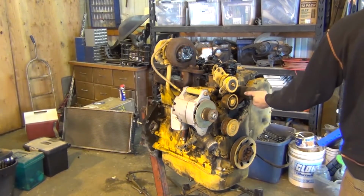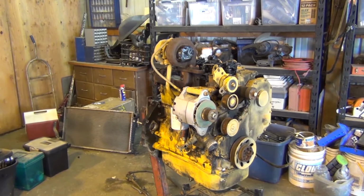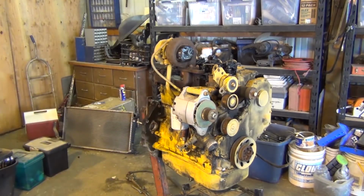Somebody's gonna comment and be like, "Hey, you should have went with a 6BT." It will not fit, guys. I mean, it can. My first thought was, you know, the 6BT is cheaper. There's more of them out there. I was gonna buy a truck and just make it a donor truck for the Expedition. We measured, guys, the hood on that Expedition and the F-150s, they dive off really fast, and it's a stubby front end. You need 40 inches to be in the clear, 40, 41 inches. The Expedition does not provide 40, 41 inches.